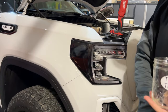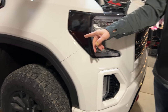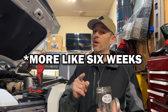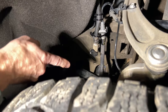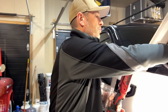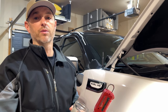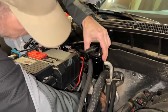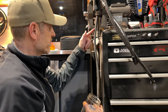First we're going to drain out of the drain plug and see what's there. I'm going to be very thorough in this video — I'm going to not only drain it from the line but after that, even if I have to unclip the cable ties holding that drain line, I'm going to take the reservoir off so we can see everything after one month of use in the cold and in some pretty harsh conditions including the off-roading. I took the whole assembly out so I could get a nice straight gravity feed.